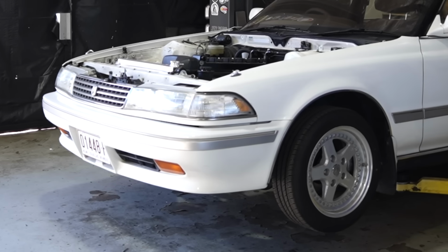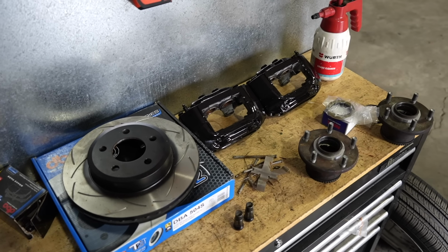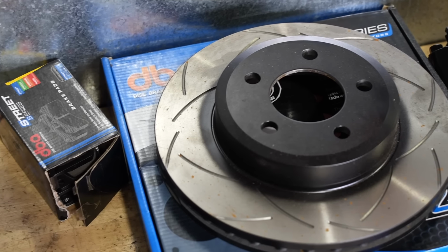This week we are back on the GX81. We are doing a front brake upgrade, the fabled internet history story, cool stories brake upgrade. We are putting R33 calipers on using BA Falcon discs. We do have hub-centric rings, which I actually machined up already.